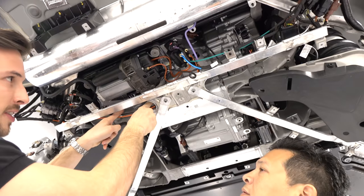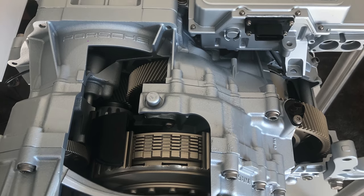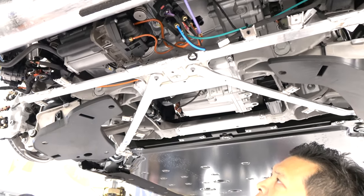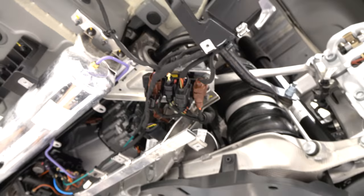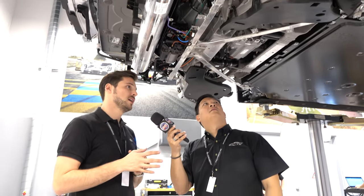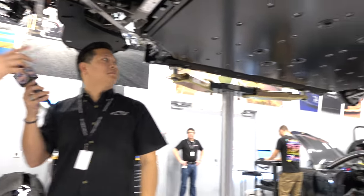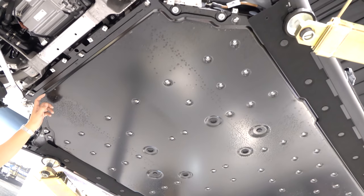The motor is actually on top here. Through here you can see the motor, here we have the gearbox, and here we have the differential and the Porsche torque vectoring entity. Similar to a normal car, you have a gearbox and differential — but here we have the electric motor, and on top of the motor, though you can't see it here, is the pulse inverter. In terms of chassis, you have about similar components to a conventional car, but in terms of the drivetrain itself, much fewer components. The biggest component is actually the battery — and you can see the battery bottom, with a very thick steel plate for safety purposes.